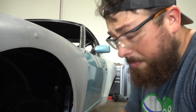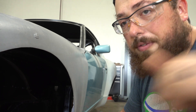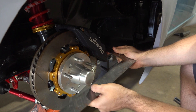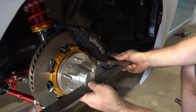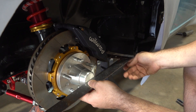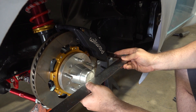The next thing I'm going to measure is the actual brake diameter. Since I know a 17-inch wheel is going to clear these brakes no problem, this is really just for reference. Using the framing square from the center — there's a machining mark right in the center of the hub on this one — you take the framing square and measure the clearance to the caliper. That distance is the brake radius; multiply by two to get your brake diameter. Then move it through the stroke — put it at the top, see where it clears, put it at the bottom, see where it clears.